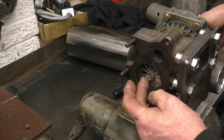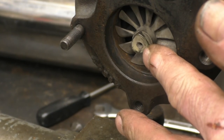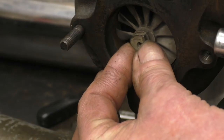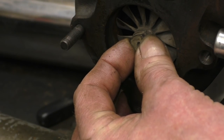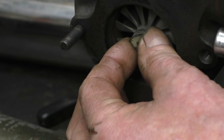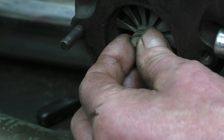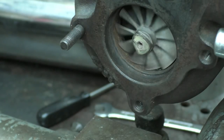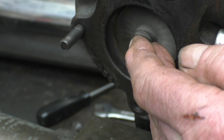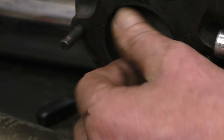The end of that bullet is pressed in - that's the nut that holds the turbine wheel on, and you can see it's a funny shape because it's been ground to balance it, nothing more nothing less. This turbo's in good condition and you've still got radial play on the bearings but there's no end-to-end play. That clearance is taken up by the oil - that's perfectly normal and perfectly acceptable. A lot of people see that and think the turbo is scrap; it's not. It's when you get end-to-end play that you've got problems. That nut is a funny shape because it's been ground - you can see the little marks where they've been grinding to balance it, because this runs at anything up to 100,000 RPM.